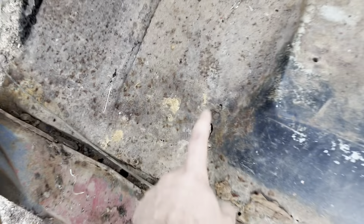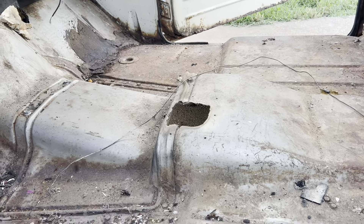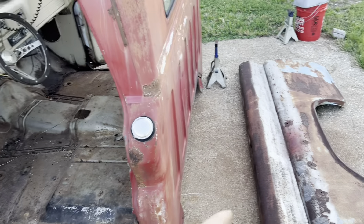The whole floor is not too bad except - oh, that's air conditioning, that's all that is, air conditioning. So we'll see what we can do about fixing that. The bad thing is though, this little piece right here, that's the cab brace and that's underneath, so I want to replace that as well before I do these things. I'm gonna have to replace that hole there too, so I think what I want to do is flip this cab over on its back.